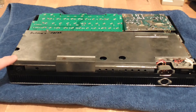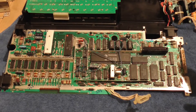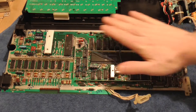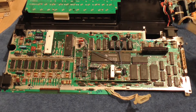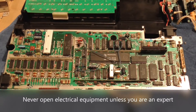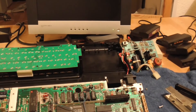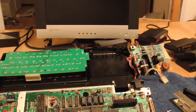I'm going to take off the shielding to have a look at the CPU and graphics chip, which is probably the most interesting part of the machine. The board is normally the other way up and has a metal RF shield over both sides, with the two halves bolted together and metal clips on the top and bottom. I was very surprised to find a power supply inside the machine — presumably it provides different voltages to the main board despite the already large external brick.